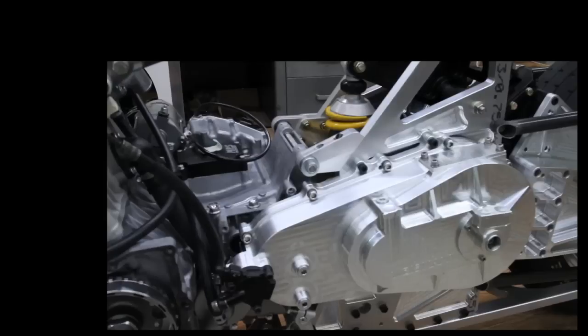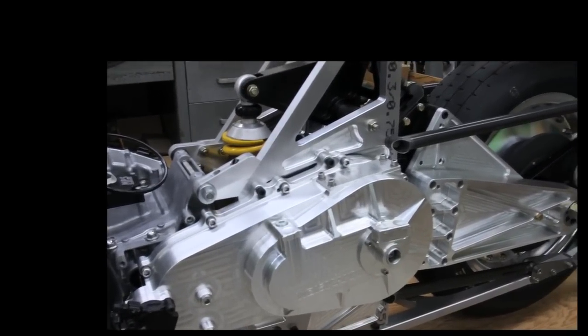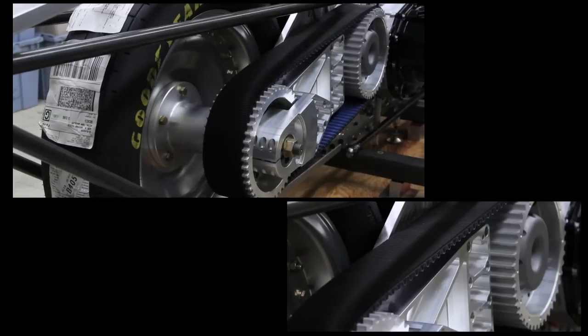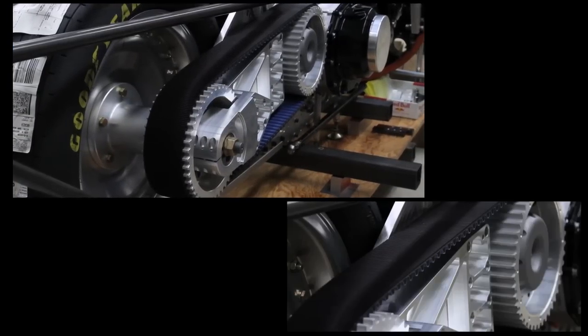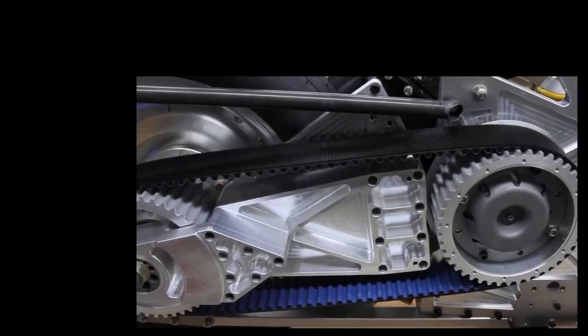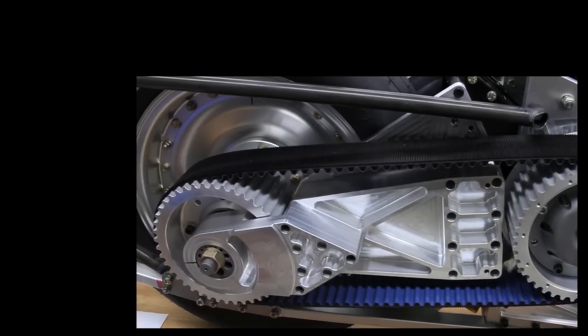Because of the new wheel, we had to come up with the rest of the stuff to hold it. Now the engine is going to produce up to 600 horsepower, or can produce that much. So that meant a whole new drive system. We've always had trouble with the chain. It was only good for really one pass and should be replaced after that. So we've gone to a belt drive, and it's good for 600 horsepower forever.